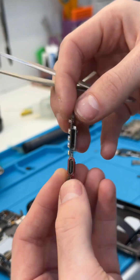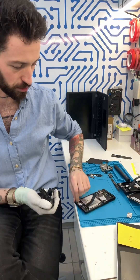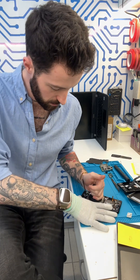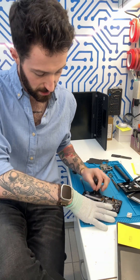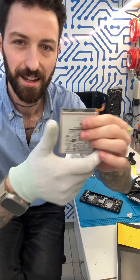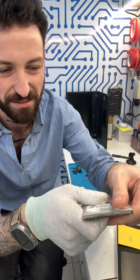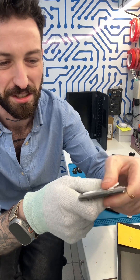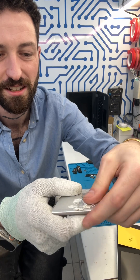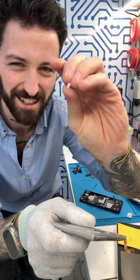Okay, it's been on the heat pad for a couple of minutes. Let me try not to burn my hand. Get our little suction cup on there, and as you can see, gently pry out the battery. Super easy to remove — doesn't take much effort. Then there's just a little bit of adhesive left underneath; you normally just have to sit there for a minute or two and squish all that adhesive off. It comes off — it's kind of like a little chewing gum, but I've tried it and it's not as tasty.